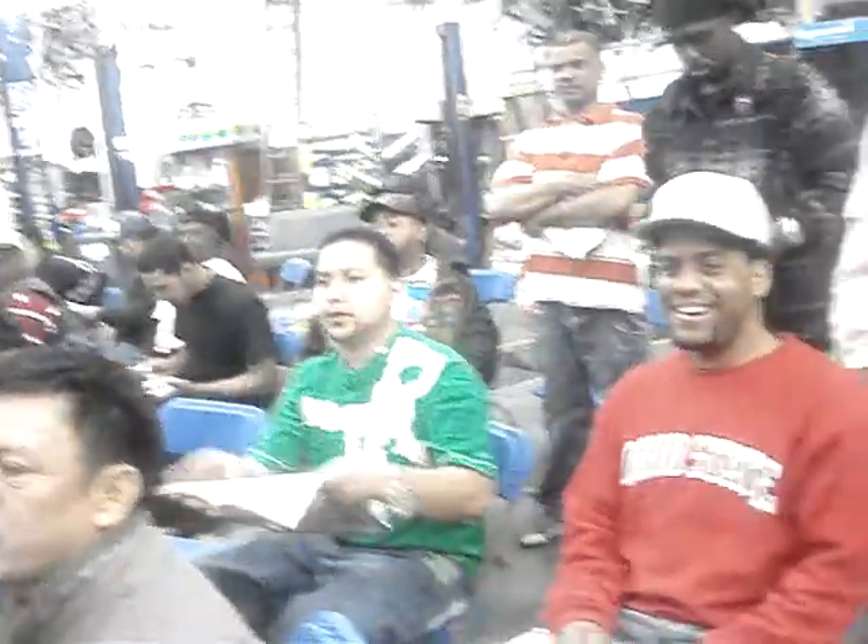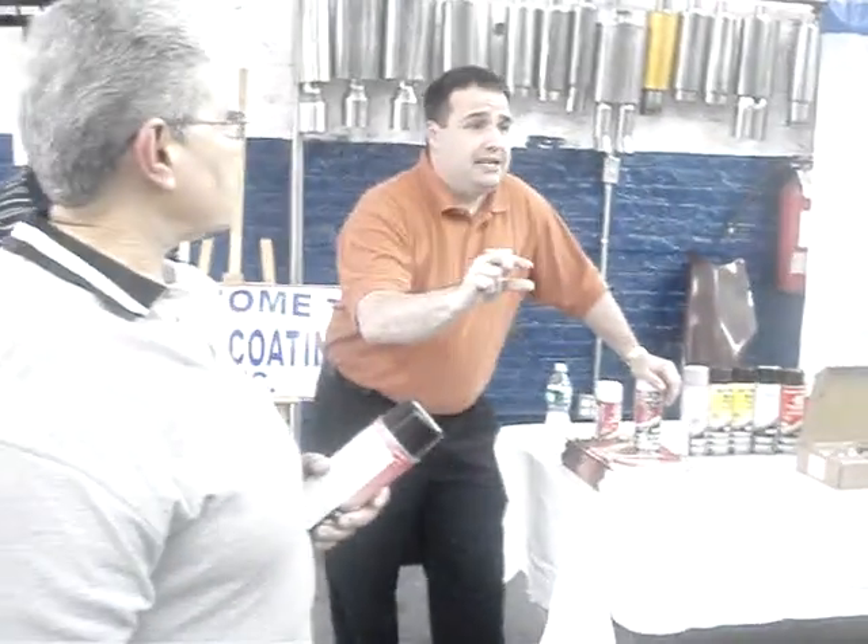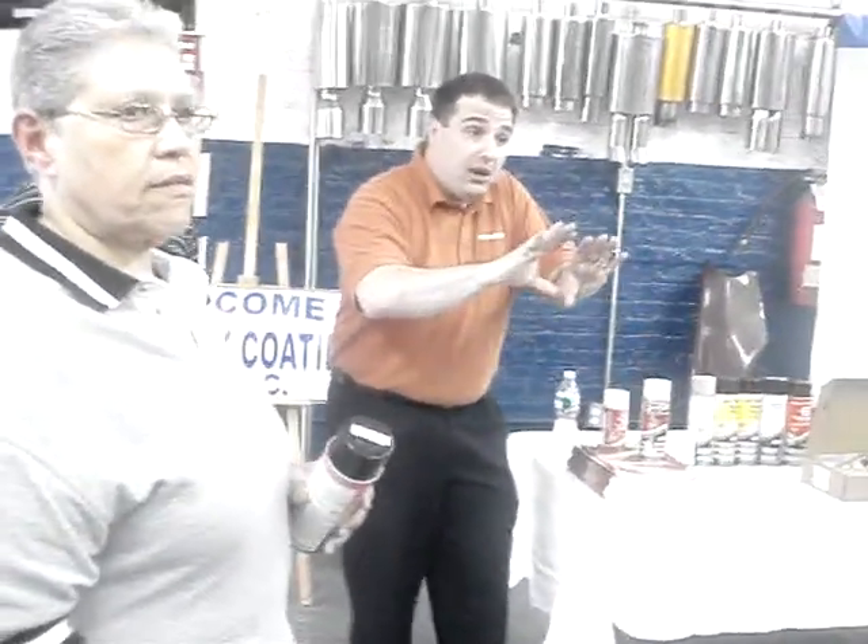This is chip guard; this is Texco. Sometimes a customer's car has a heavier texture finish. What you can do is fool around with the nozzle. Hold it halfway down and you'll get a different pattern; hold it fully down and you'll get a wider, heavier spray. But the secret to matching that finish is to put many coats on it — not just one heavy coat. You want to build up to get that texture. If you try to do it in one or two coats, that's where you're going to have the problem matching.